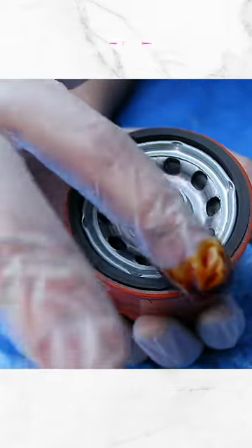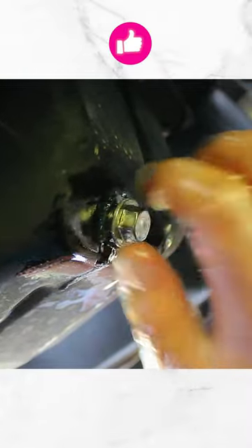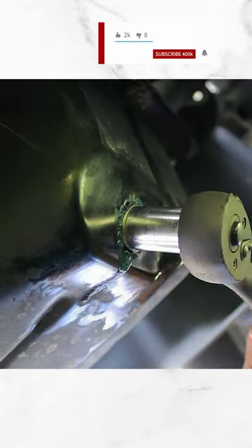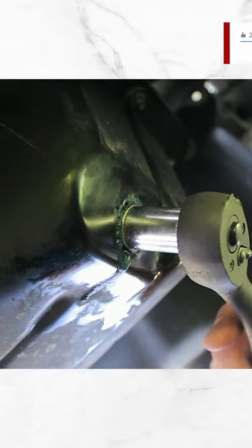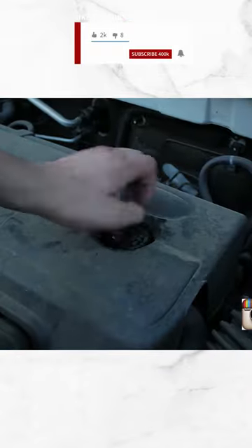Place some oil around the ring of the oil filter. Now get ready to install it, and remember: righty tighty. Once you see the oil stop dripping, go ahead and place the bolt back. You never want to over-tighten the bolt — once you feel it hand tight, that will be sufficient. Now let's go ahead and place the new oil in.